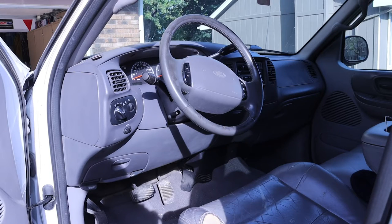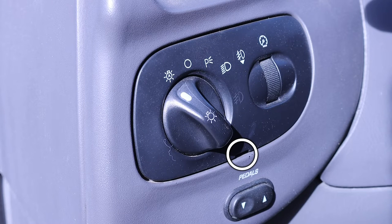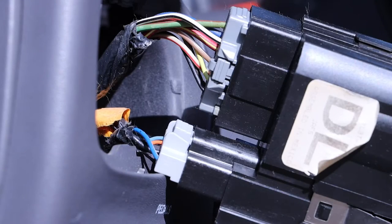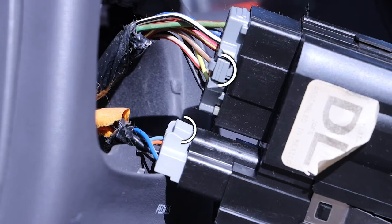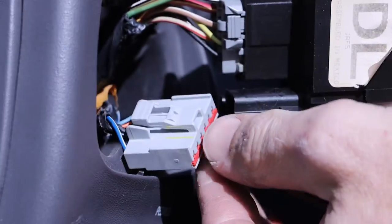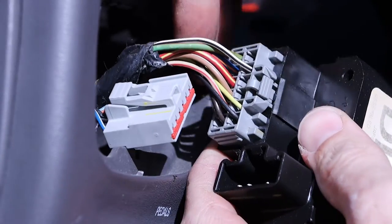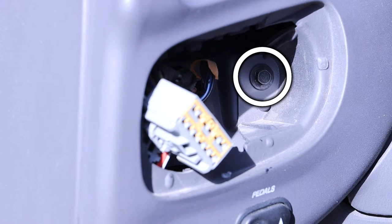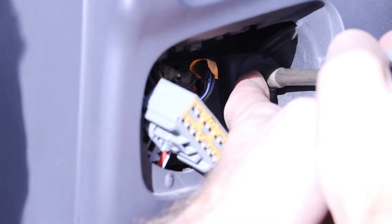Taking a look through the driver's side door we want to locate our headlamp switch. At the bottom of our headlamp switch we have a small slot for a trim removal tool and that headlamp switch will pull straight out. After pulling it out we have two wiring harnesses each held on by small plastic tabs. We need to depress the small plastic tabs and wiggle the wiring harness free. Behind that wiring harness we have one bolt that we need to remove, using a 9/32nd nut driver, although it is possible this is a metric size.